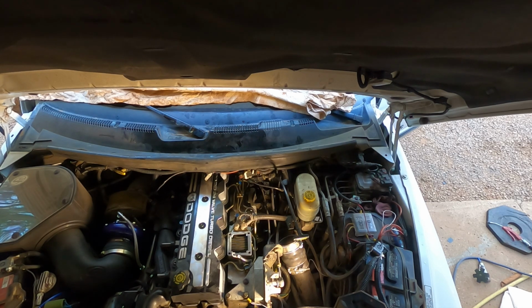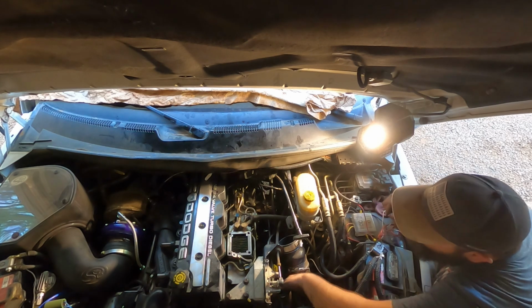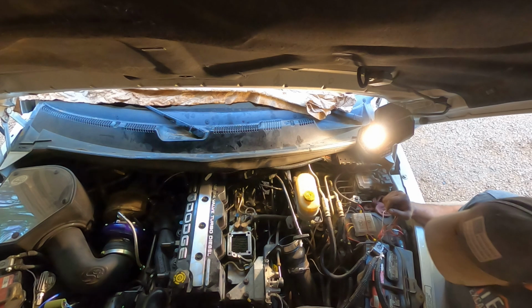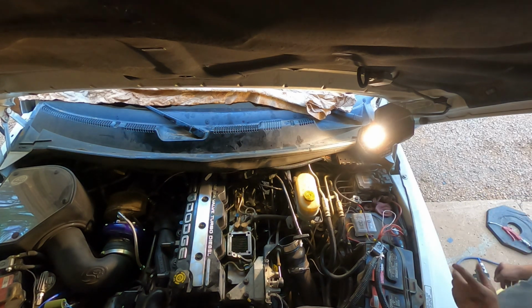So when you start getting the fuel system back together, you want to blip the ignition on the truck just to barely crank it over so you can keep that fuel pump running to keep on sending fuel back into the motor. So now I'm just checking all the lines, making sure everything from there is all right. Yeah, my air dog's kicking on, so it's starting to put fuel into it. I know the injectors are bone dry.